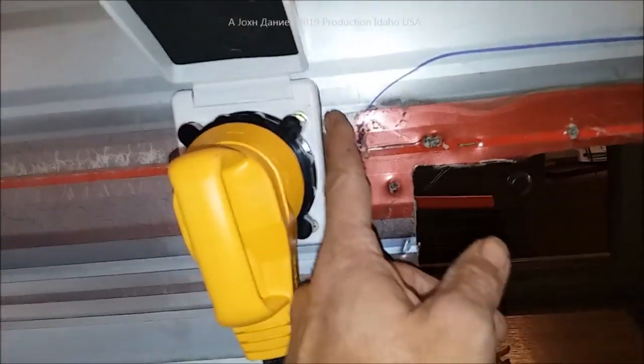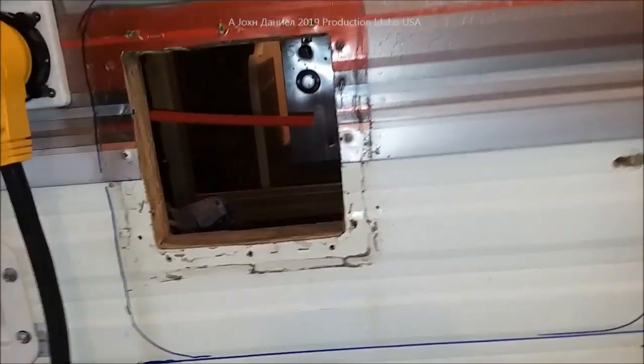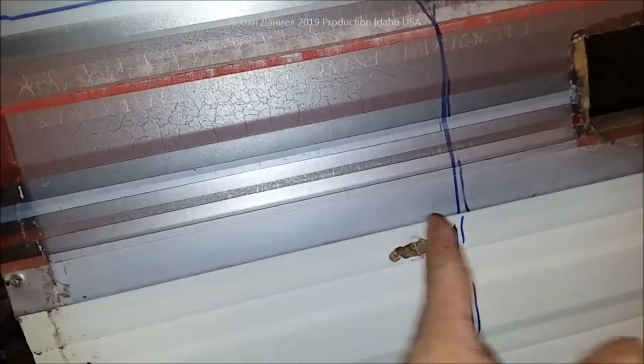I had to find where it's going to be - it'll be very close to this edge here. There'll be some studs removed but this is a heavy gauge so it's structural. We'll also be boxing in the back and adding more plywood to bring up the strength again. Once I cut this, I'll be cutting two studs that are in here, but I'm also going to insert studs back in and frame it back. The first thing is to find where that stud is, cut the sheet metal first, remove the insulation, and then find out what we can work around to get it installed.